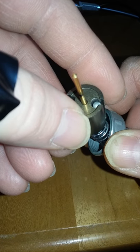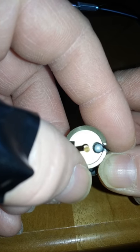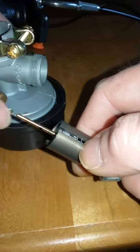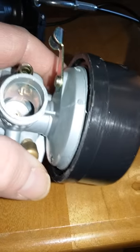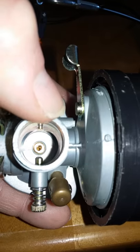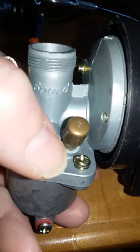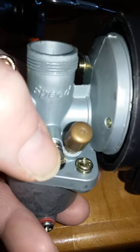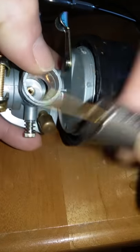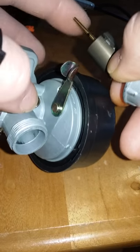Take this out and you see here this line, and see how you've got your cable — that little dot in there — you've got to keep that lined up with this line right here. Now inside here where it goes in, you see that little copper nub sticking out right here — not the throttle screw, not the adjustment of the throttle screw — this little thing sticking out.